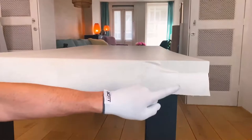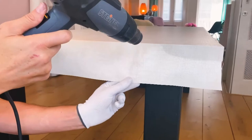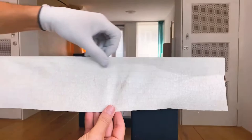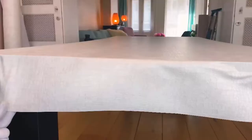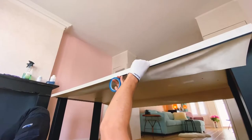Once both corners are done, finish the film in the middle of the area. Add heat so it softens the film, then once relaxed, pinch the top corner for a tight seal and form the film to the bottom outside edge. Work in increments from right to left towards the middle — try not to squeegee too much at one time. Once the sides are close to the middle, add heat, pinch the corner again, then relax the film as much as possible towards the bottom. Avoid heating and stretching excessively, as this will over-stretch the film. Wrap all the material around the underside.